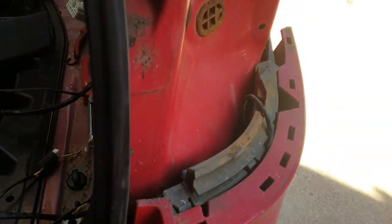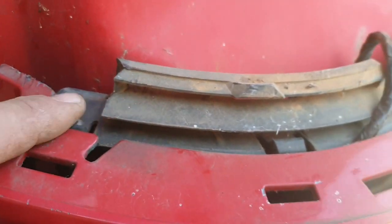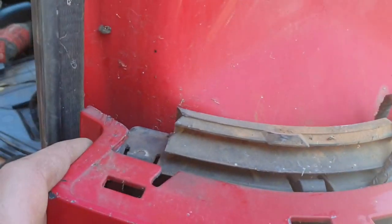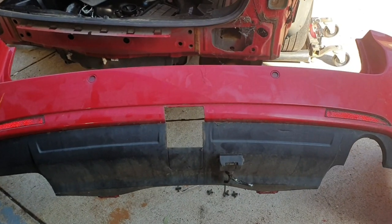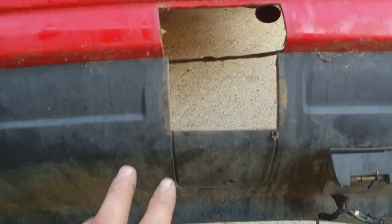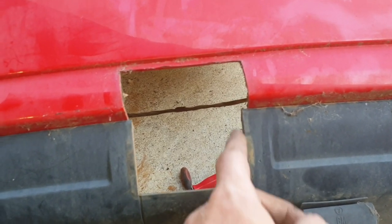What I've also done is pulled the tail light out to show you how the bumper is actually clipped on, so don't be afraid to pull it back. And then obviously to reinstall, push the bumper back on and put those screws back in that you pulled out. The next thing you have to think about is where the tow bar hitch comes out — on the bar it's got guidance lines, and I'd start just on the inside of those if you're going to cut it.